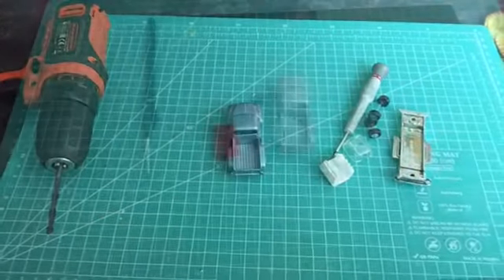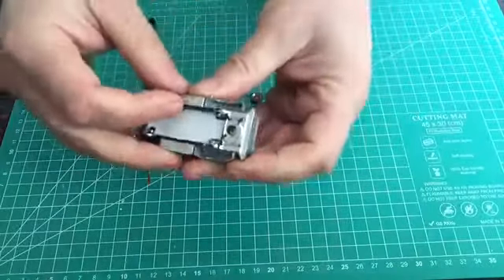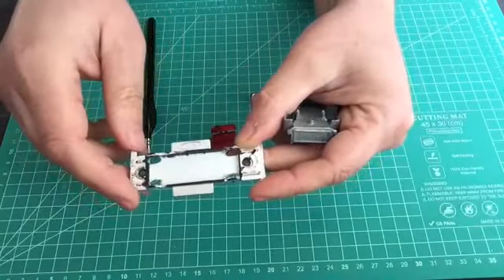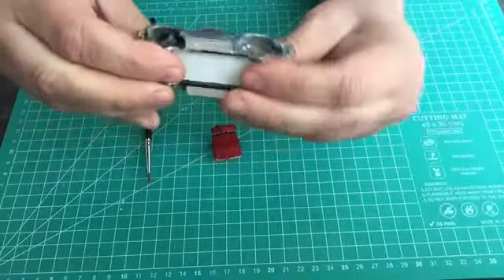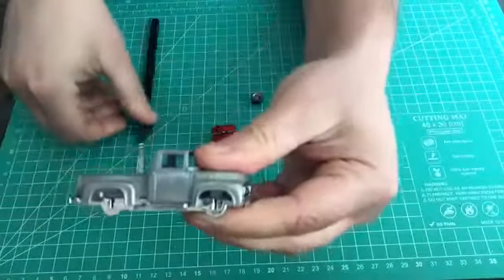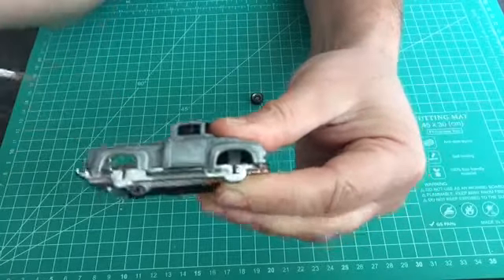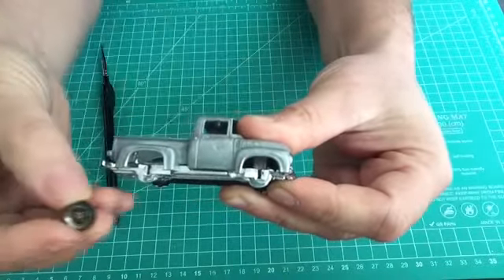Here's the vehicle after paint stripping — all the paint's been removed. I had to do a bit of modification to the base plate to get the suspension lowered. I cut out the centre of the base plate because it protruded quite low down and would have stopped the wheels from sitting high up in the arches. I'm going to re-stick the centre of the base plate further in. The running boards also need work as they're in the way and not centred to the cab, so I want to cut them off and realign them.